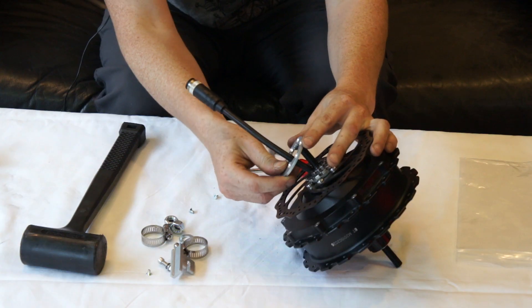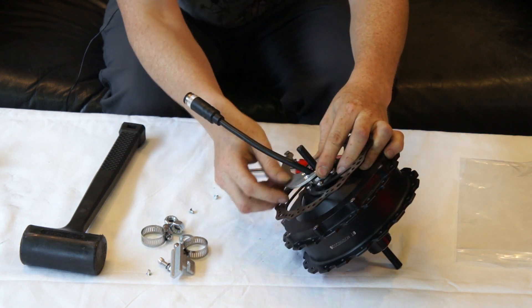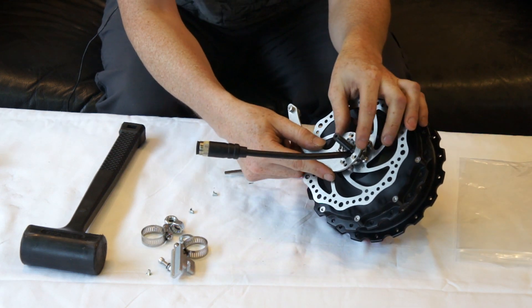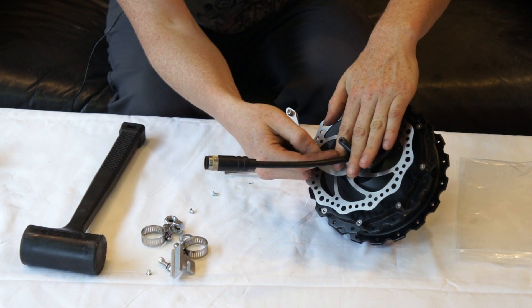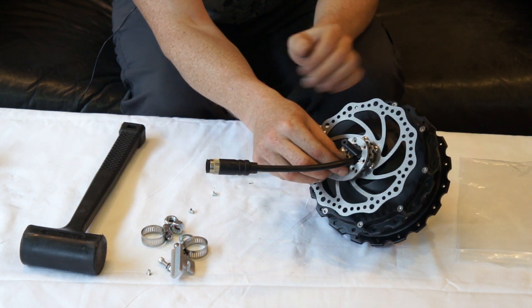The torque arm has 12 different positions it can be oriented in, with notches that can align it in each of those spaces. The correct alignment is really crucial because once the GMAC motor is installed, this cable has to come out through the dropout slot itself — you can't have the cable being squished inside or you'll sever the sheathing.